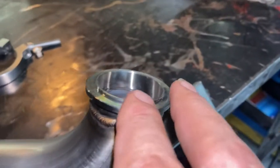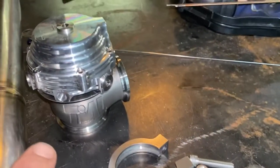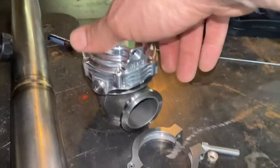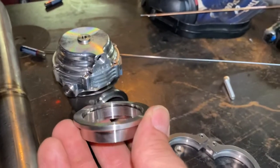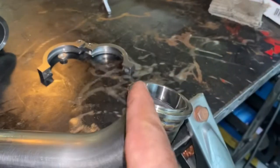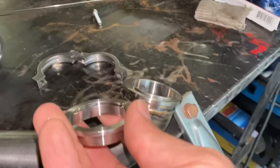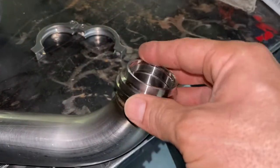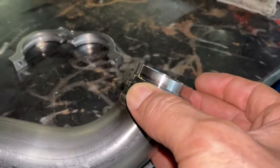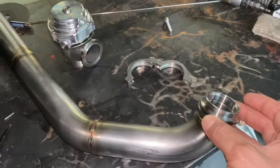The owner of the vehicle ordered this exhaust that came with this flange, but the Tial wastegate that he ordered has a female portion that goes here. Two different reasons why I have to cut this one off and put a new one on: male and female — you can't put male on another male, anybody knows that's a no-no. Also the second reason is these are two different sizes. The one that came with the Tial is fairly small — you can see it's pretty even on one side but over here you can see the difference, and that makes a big difference when installing the wastegate.